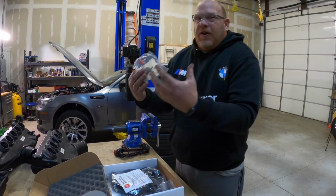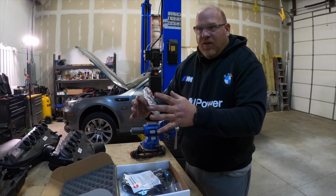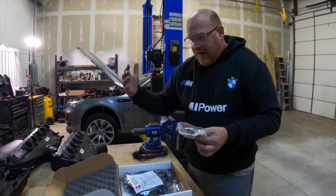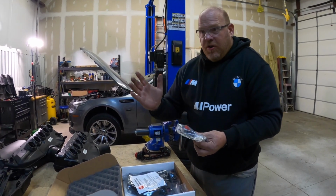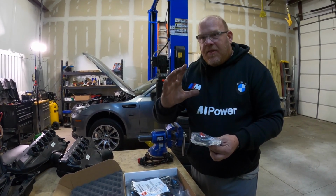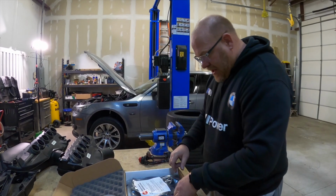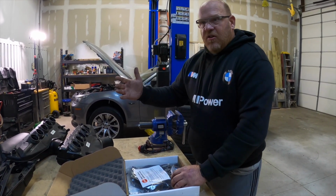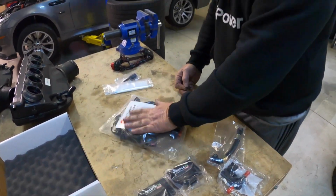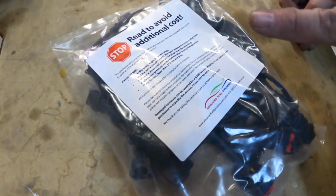If you tune your car for E85, 100% E85, then you've got to make sure that it's getting 85% ethanol, 15% gasoline. This little beauty here actually will adapt, and there's a phone app that will show you. We're going to start the car and run the car, and there's 91 octane in the fuel tank, and it's going to show you the amount of ethanol that's in that. So it constantly adapts itself. It all depends on how much ethanol you put in. So you can go full E85. A lot of the gas stations you go to, their E85 ethanol can be, like I said, anywhere from like 51% to 85%. So I think something that's important, you know, is a lot of us just tend to grab stuff and put it in, but they make it very clear here, some do not do's.